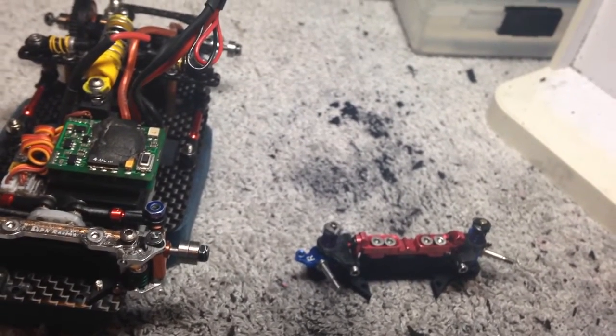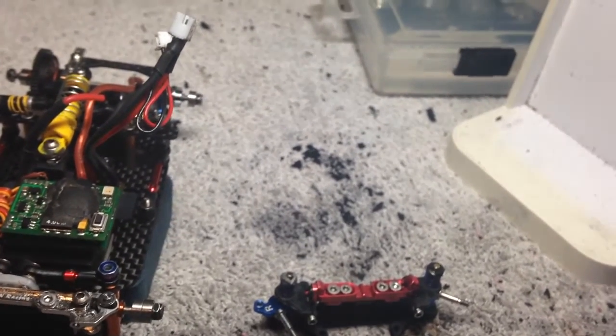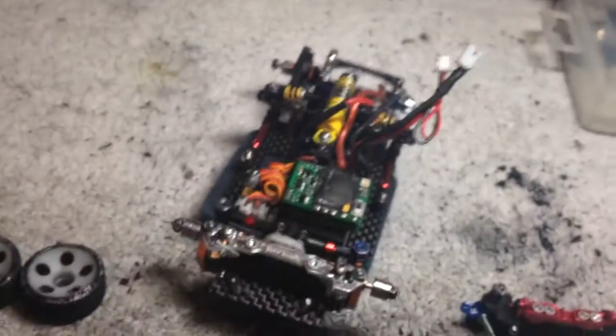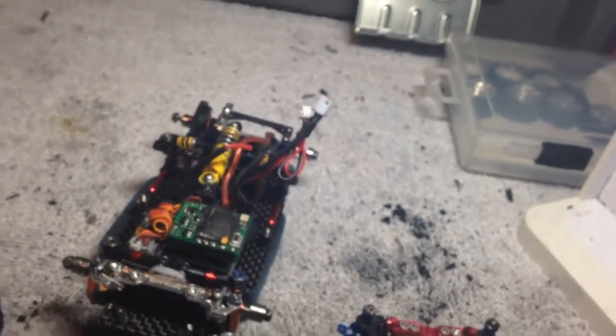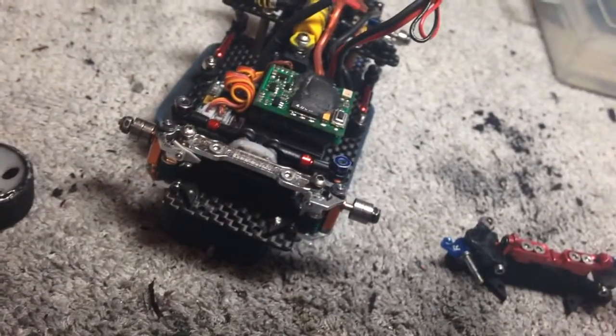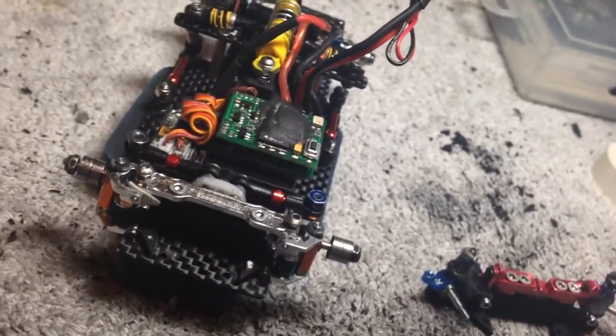Just don't glue the front tires like I did, because once you figure out your setup, then you're gonna regret it. Because maybe at the very beginning you're gonna feel like you want to glue those sidewalls because it's gonna want to flip or oversteer. But when you figure the setup out, actually you'll notice it has way more rear grip than the 03. So keep that in mind.